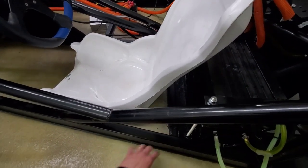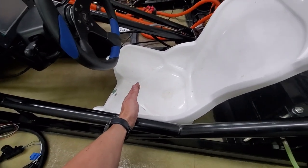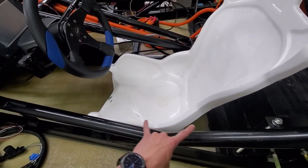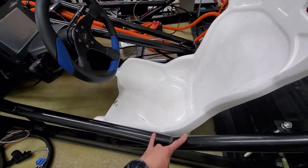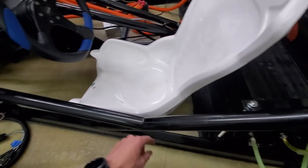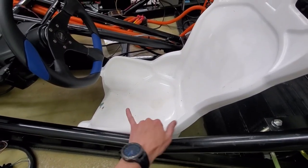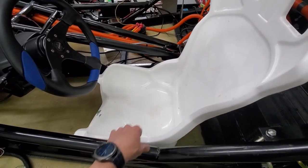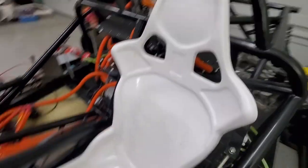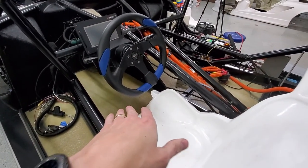So my thought is there's the fiberglass, but there's no real mounting points. They've got one bar here and then one way back here, and if I want this adjustable — I ordered some adjustable rails — but I want those mounted to steel. So what I'll do is weld a piece from here to here, then I can just bolt on the adjustable frame rail, and I'll do that in both spots. But I don't know exactly how to line this up because it's quite tight — I'll call it somewhat F1 style where it's pretty difficult to get in.